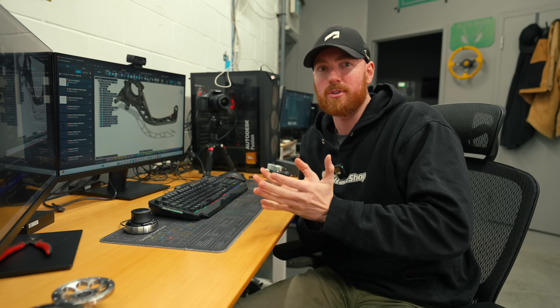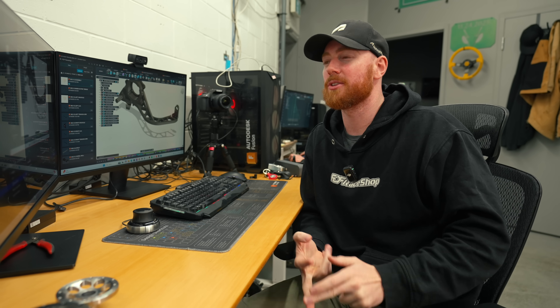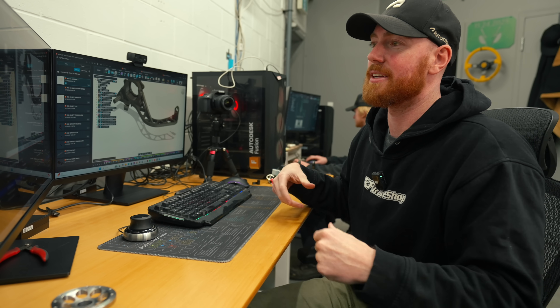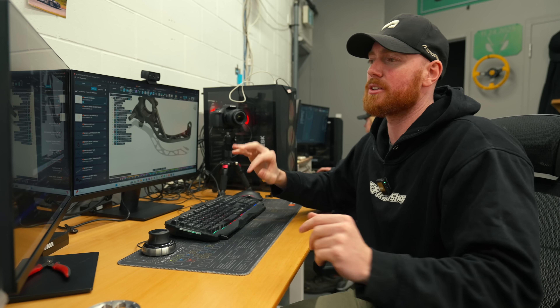Real-world testing on a real car — and fortunately for drifting, these guys really like to hit stuff. When Conor O'Sulley is breaking wheels and just barely bending arms but the trailing arm is still intact, we've done the job. Wheels are easy to replace; trailing arms, not so much. We want to make these strong enough that they are not the sacrificial point, but we also don't want the subframe to be sacrificial either — we need something to give in between, with wheels being the absolute easiest. Adam runs very expensive BC Forged wheels, and they are very strong. In a lot of cases in drifting it actually makes sense to not have such a strong wheel, because it's the easiest thing you can replace if you hit something.